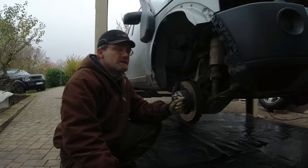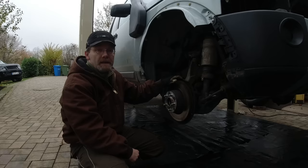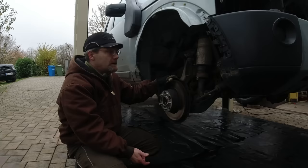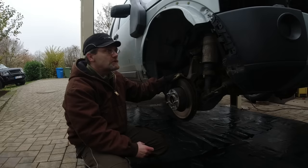So if your vehicle is lowered down in the morning when you enter it — it's limping — that's like when you're waking up your dog and it's limping on three legs. You've got to get it fixed, otherwise the dog's going to die. Same with the Discovery 3. The diagnosis this time was actually done by Vera. She found out all by herself which corner of the vehicle had the problem, and then all I had to do was go there using some soapy water, actuating everything, and detecting the problem. All we've got to do now is replace the air valve, put our new tires back on, and take the car to a TÜV inspection — hopefully we're going to pass.